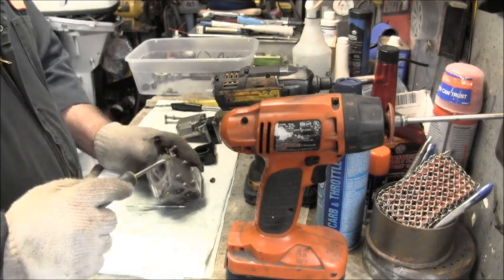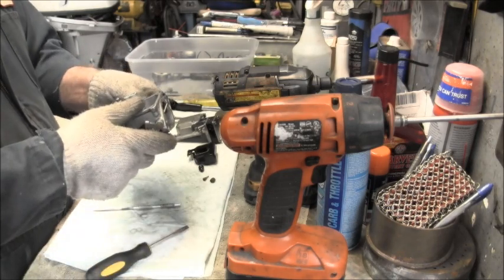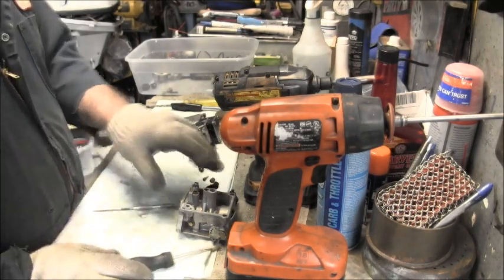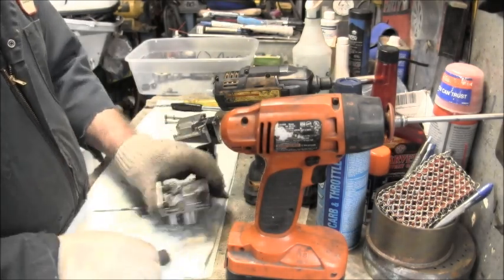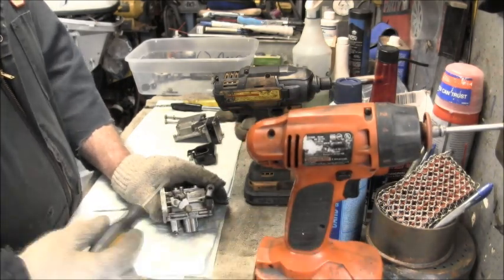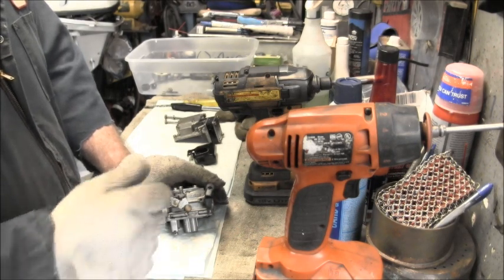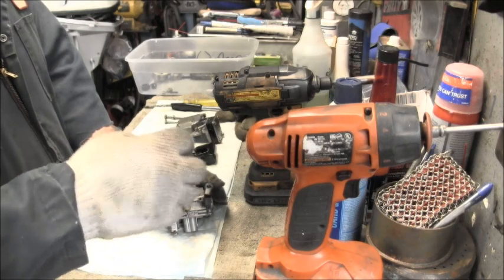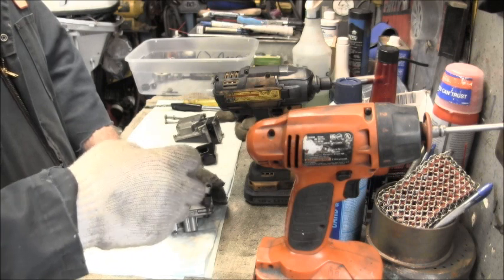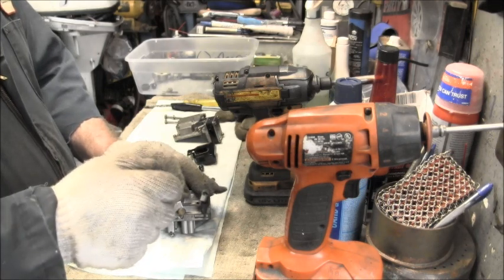I'm going to have to go in here. Oh, there it is. Beep. There. So how we doing? I'm gonna push that out. There we're good. We got the jets out. Now I counted this in. I don't know if you saw me doing that. I'm sure you did on the video. It was two turns to a light seat going in, and then I backed it out to 2.5, then 3, and it didn't change. So I know that the initial setting on this needle here is two turns out from a light seat. We know this.